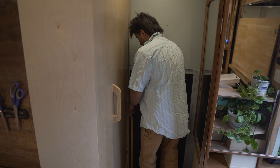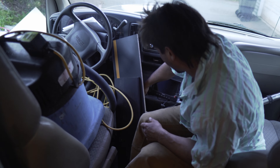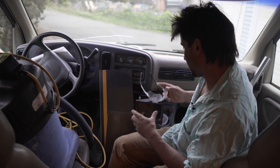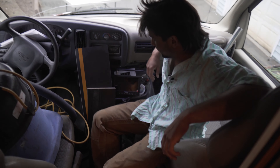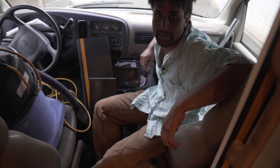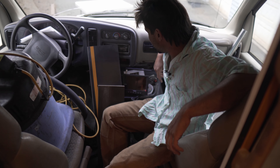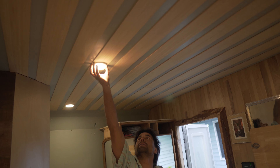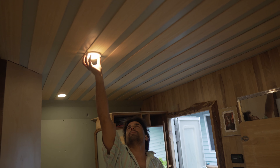If you want to come check out the cockpit here — right now it's kind of the storage locker for everything. I got a backup camera, which is pretty sweet. I normally just drive by braille and hit things and hear people yelling at me, but now that won't happen. I've been using these 12-volt puck lights — pretty sweet, from Home Depot or Amazon. They come with a transformer because they're meant for houses, but you just cut that off because they're 12 volts. Super simple — use double-sided tape and stick them up. The wires are small so they're quite flexible on what you can do with them.